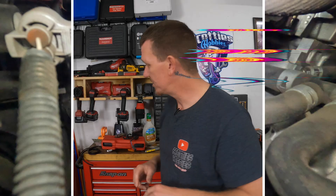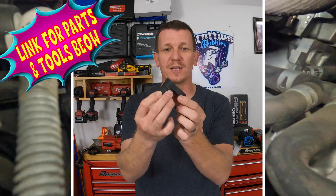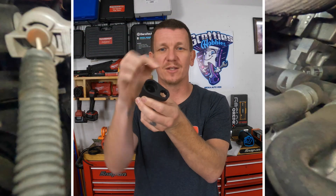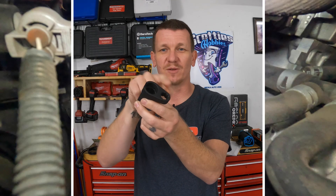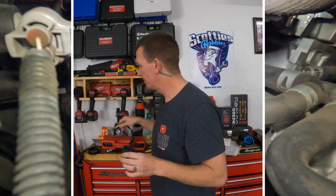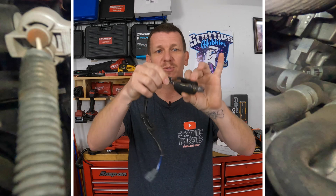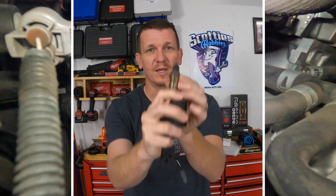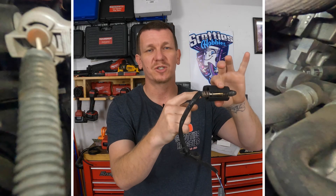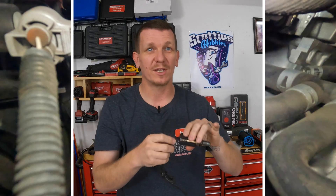Now, if you need to replace the oxygen sensor, I have a kit. This one happens to be my favorite oxygen sensor socket that I've been using the most lately. A half-inch socket wrench fits inside here, and there's a little star so it can fit in a bunch of different directions, making it very useful — much more useful than just the actual square one. This slides right over your oxygen sensor like so, grabs on to the hex head of it. You put this on, slide it on, get your half-inch socket wrench or extension, and just turn it, and this will loosen it right up. Really easy to do.